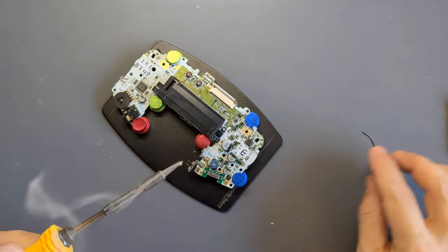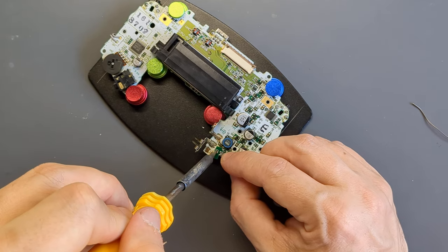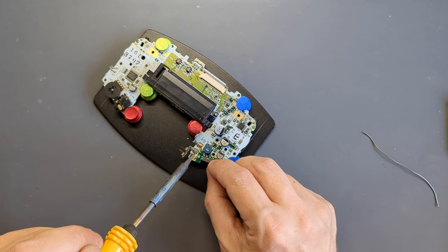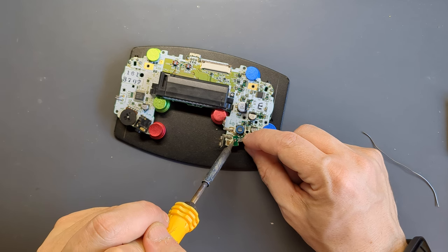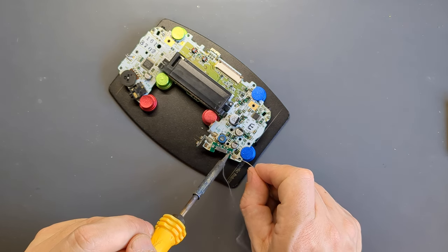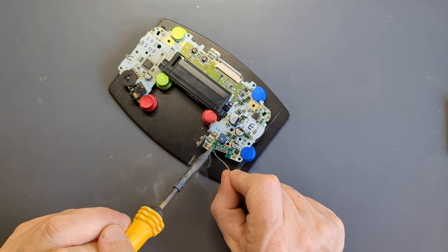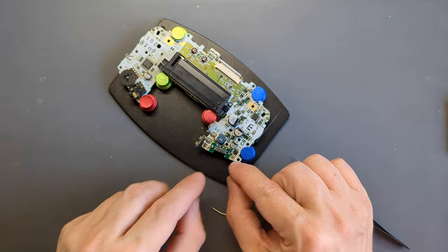I started with the left anchor point. I got it roughly in place and melted some solder into the hole, then held it in position and put the point of my iron right into the hole so it made contact with the motherboard and provided a secure fit. When I inspected the switch afterwards it was clear that it wasn't quite centred, so I reheated the pad, moved the switch and let it cool. I repeated this a few times until I was happy it was in the right spot. After that, a visual inspection showed it was lined up correctly. However, with it being so close to the other components and the four main pads being tricky to get at, I decided to move it out so it overhangs the edge of the motherboard ever so slightly. I then soldered the anchor point at the other end and added a little more solder to each of these two points to secure them and ensure enough solder had flowed down to attach it to the motherboard. I tested the movement of the switch — it's actually got a much more satisfying click than the original part and felt really sturdy in place.